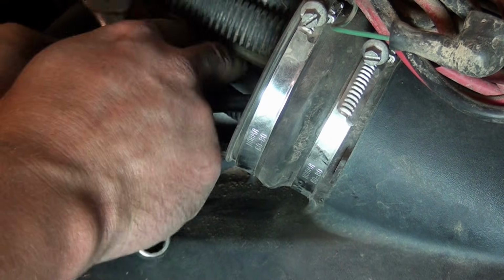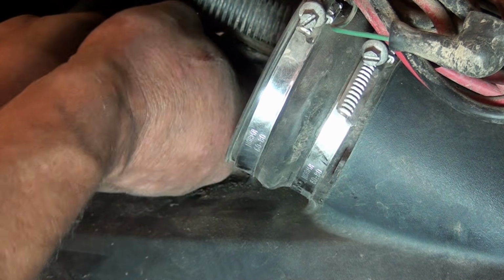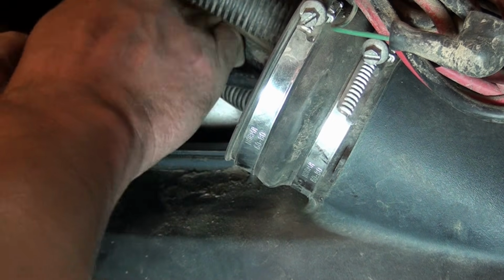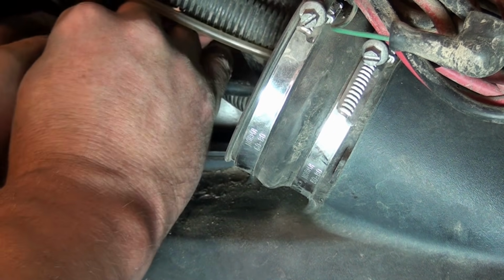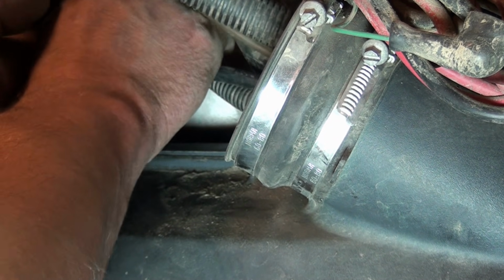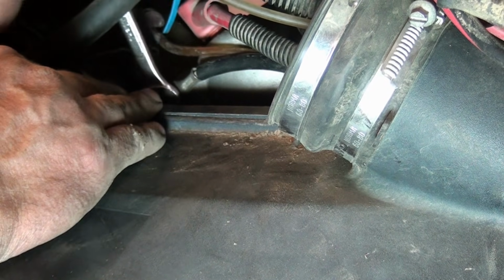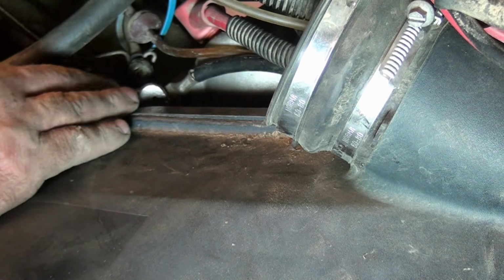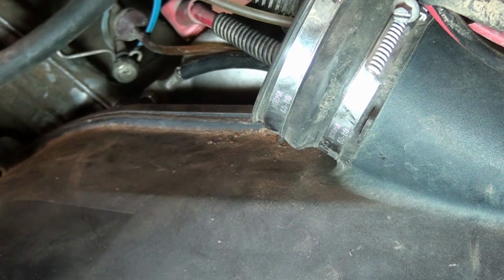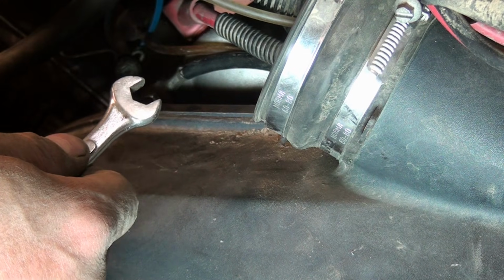I mean, I suppose you could hook that ground terminal up initially, but I kind of wanted everything out of the way so I could get that lower bolt threaded. Probably can't see anything but my hands, but all I'm doing here is hooking up the positive terminal, and I'll replace the red boot when I'm done with that. Alright, so my ground wire is back, my positive terminal is back. I've got both bolts snugged down so that the lock washers compress, and then I snug them down even more, but you obviously don't want to overtighten them.